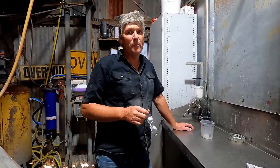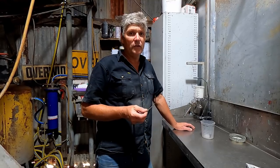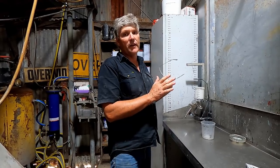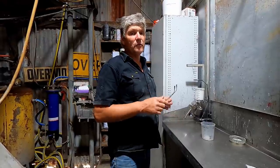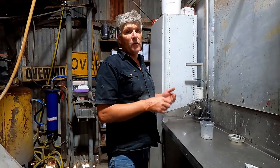So the paint's going to dry pretty quickly. And you could say it's a good thing. It's not really a good thing. You can get a bit of solvent problem with that, where the top layer of paint will dry and you'll have stuff underneath it, which the solvents are still trying to get through. And we can have some issues with that. But for what we're doing with primers, shouldn't really be any great problem. I'm not really worried about that. But it's a matter of spacing my coats out.